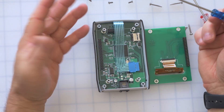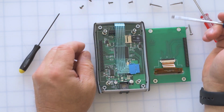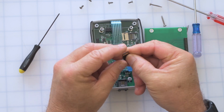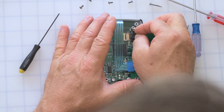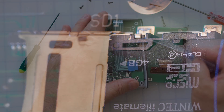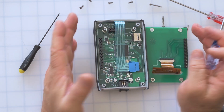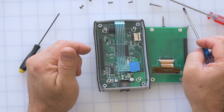Again, you want to use your fingers but I'll demonstrate with the screwdriver so my hands don't get in the way — same process. Push this down to unlock it and flip it open. Here's the card; I'll take it out. You will see the pins on the card and the pins in the controller, and that same notch. If you've knocked your hand controller around and the card has come loose, just open this back up, take the card out, and reseat it using the same process — lining up that side notch. Then flip the holder back over, hold it down, and slide it into place. You should feel it click. Give it a little bump to make sure the card is seated and secure.